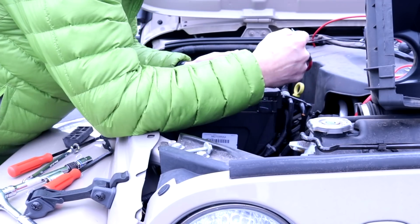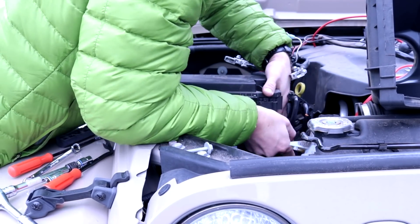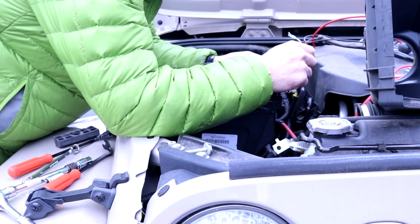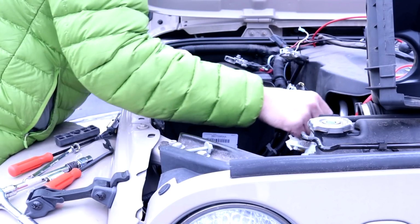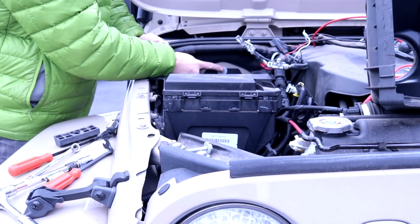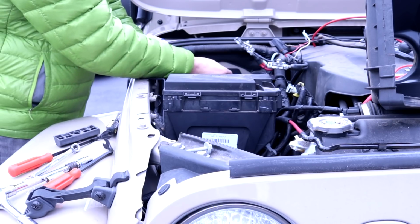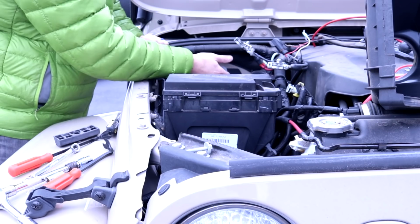Alright, so this is the fuse box connector. I'm going to slide that out of the way. Push that down a little bit. That's the connector that we're going to have to fix. My terminals. Oh, next up, we have to trim the bolts back to where the nut heads are, and then put those black covers so it doesn't punch into the battery. So we got to use a cut-off tool for that. So we're going to do that now.